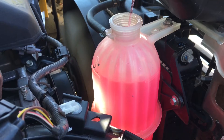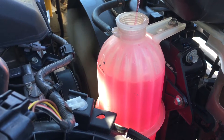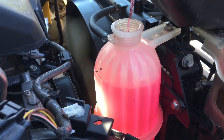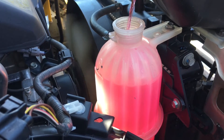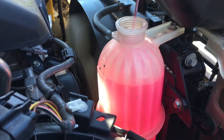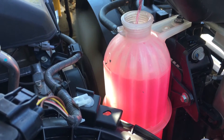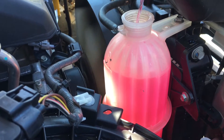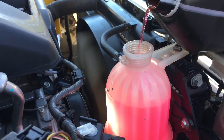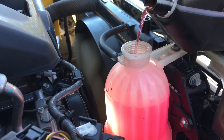On this one we've had the water pump off - changed the water pump, the big front engine job. I just thought I'd tell you how many litres it's going to take. People like to go to the books and books say things like 12 litres, but I can tell you now - have you ever seen one of these need 12 litres? It's less than 10 litres; we were just in at 8-9-10 litres somewhere there.